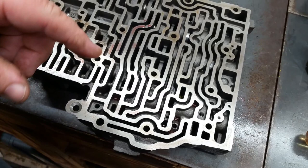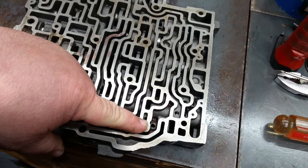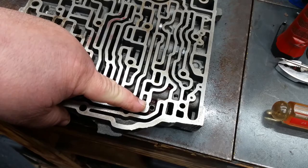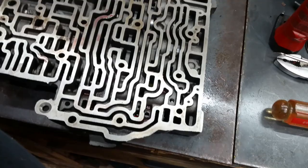All right, so you can get the oversized valve for it. It's about $45 from Sonnax. But you have to get a reamer kit to enlarge it to accept the new larger valve. Well, the reamer kit's $320, something like that. Crazy stupid expensive. So here's where the next best thing comes in.